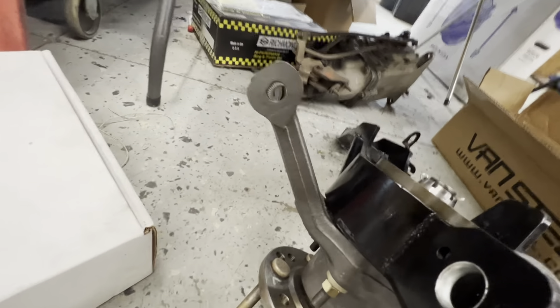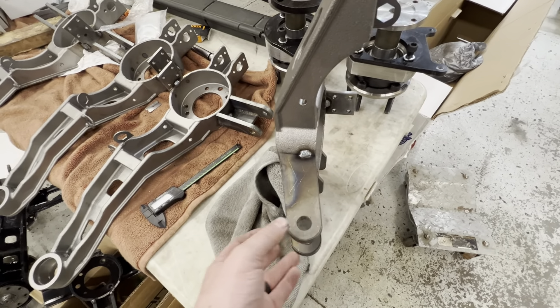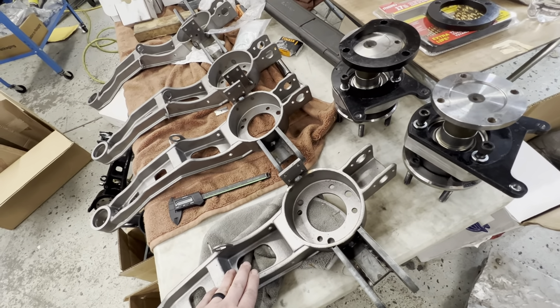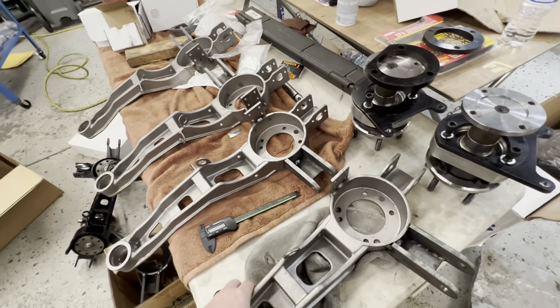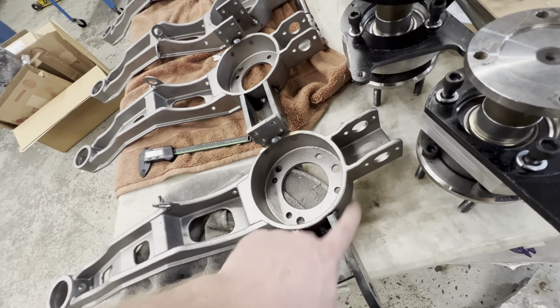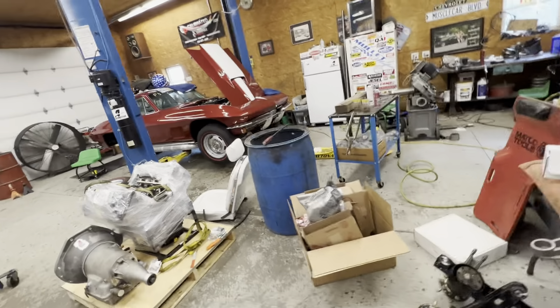You can tell how this bracket bolts to the actual trailing arm itself. Steve's got a jig to where we weld this on — this is what holds the lower camber rods and the bottom side of the axle loop, so if this thing breaks an axle it will not tear up the storage bins like we have on the black car. These are cast steel and I wanted to preheat them before welding. I tack welded them at Steve's using his jig, then I'll preheat them and MIG weld them here because it'll be hard to get the TIG welder in there and it's some thick stuff.